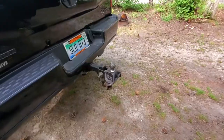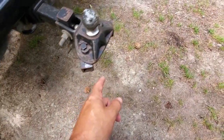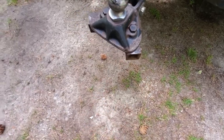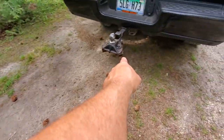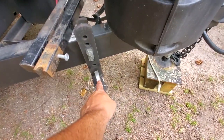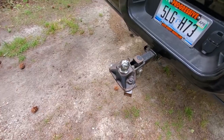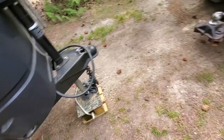I make that my first point — you can see I put it right there on the hitch. Now on these equalizers, you're not supposed to lube the torsion bars, but I put just a very small swipe right there on purpose. As I'm turning and these bars are moving back and forth — these big steel bars go in there and connect from that socket to right here — I put just that little bitty dab of grease in there just to keep them from making noise. Just a little smidge keeps that squeaking and creaking down.